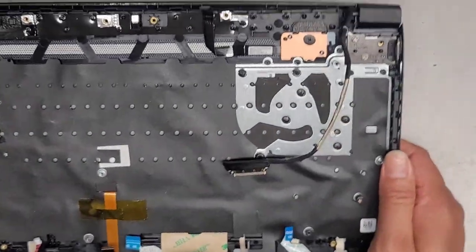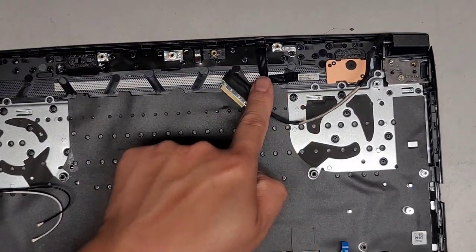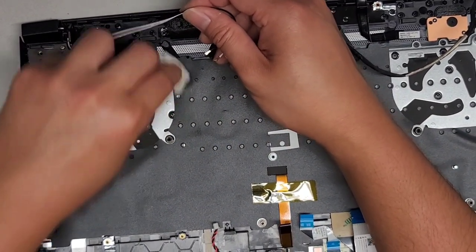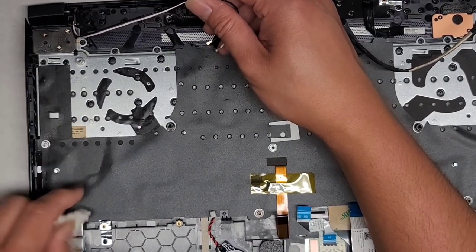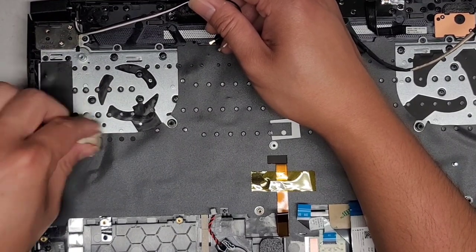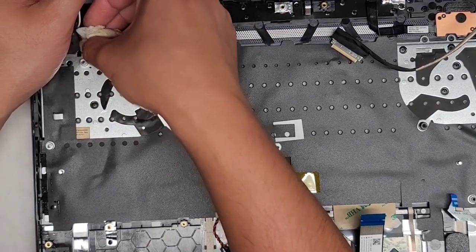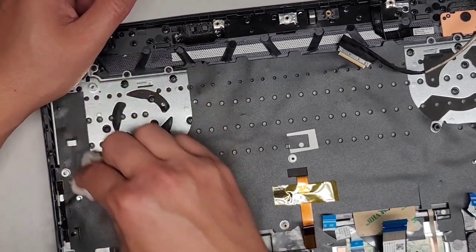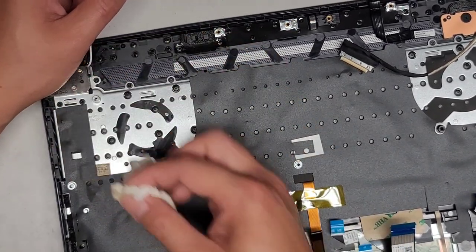Now we'll look in here. That JTRB1 connector — it's actually the turbo button. We've got liquid residue here so we're going to clean that — underneath where the fan was. The sticker got permanently stained; we're not going to be able to do anything about that because it absorbed the coffee. Luckily it seems the keyboard is okay. I'm going to open this up and use my air blower on the keyboard keys to make sure it's completely dry. Hopefully nothing will stick, or if anything dries and leaves a residue, it'll be a thin enough layer that it hopefully won't be too sticky.